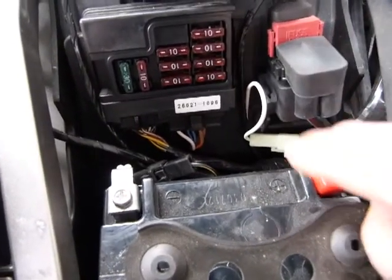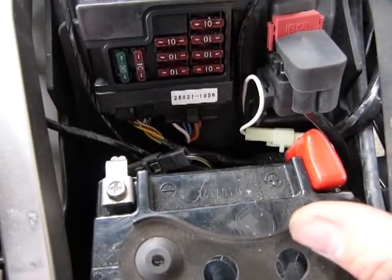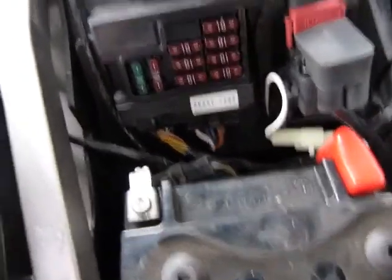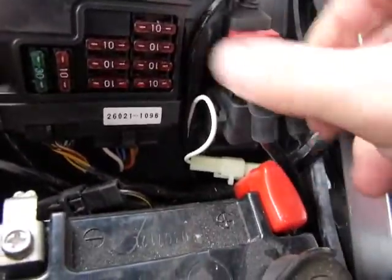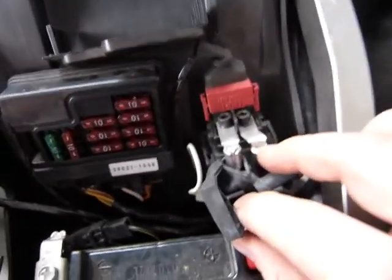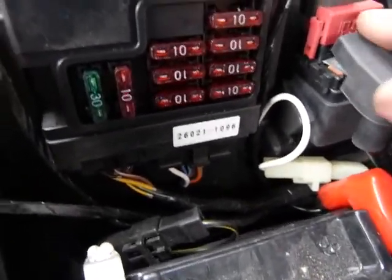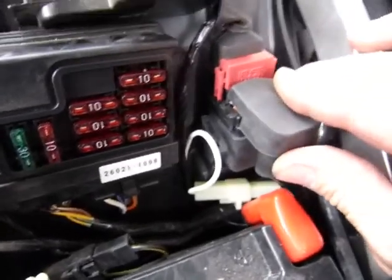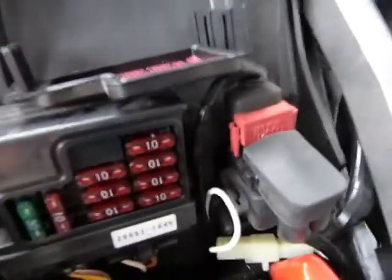When the bike starts up and the battery positive and negative terminals are powering the starter motor, power first flows to the solenoid here. There's a starter solenoid here, okay? There are other solenoids on the bike. This one is your starter solenoid, and in normal operation it should click or tick when it works. It's basically a switch. A solenoid is a switch.